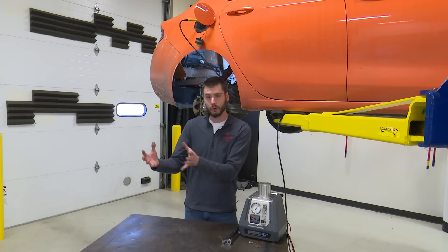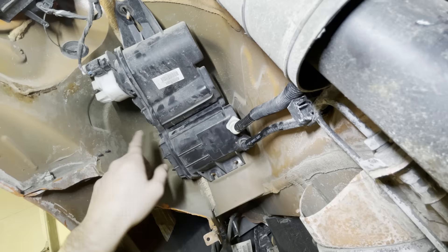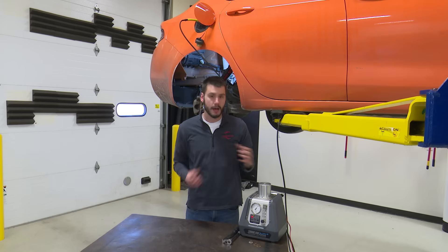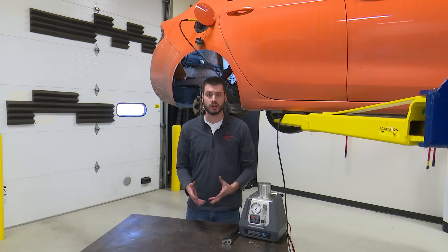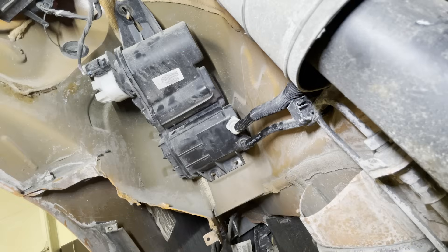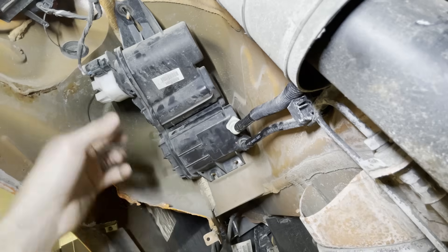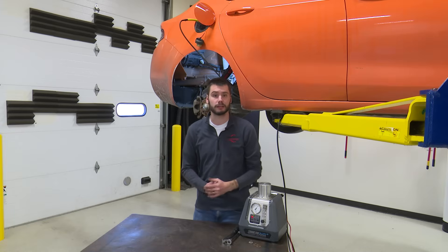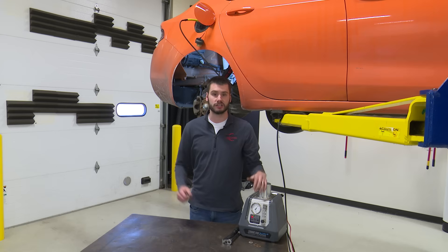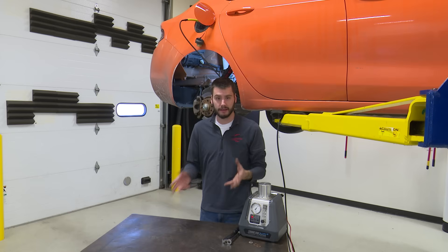The air will travel out of the gas tank through this hose right here into our vapor canister, then through our ESIM module and out of this remote-mounted filter. What we're not seeing right now is an even exchange — I'm dumping smoke into the gas tank and I should see smoke coming out of this remote-mounted section. I get a little trickle every now and then, but this entire fender liner space should be filled with smoke if there were no restriction. So we need to disconnect these two hoses and pull this canister out to bench test it.